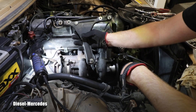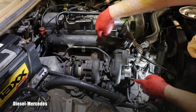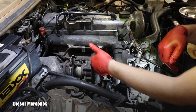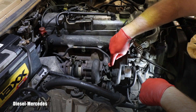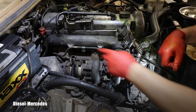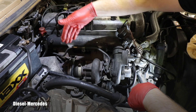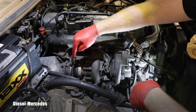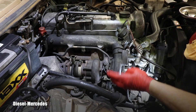Here is another crazy piece which will never come back, and this is starting to look really good. Here obviously is the turbo inlet — right here is the passage for the air going into the engine. Here is the turbo part which is getting the exhaust gases inside and they are leaving to the exhaust. Here is the oil line which lubricates that bearing. And down here is where the blow-by oil and fumes were coming into that filter, then through a special little assembly, dripping into this pipe which is the return to the oil pan.